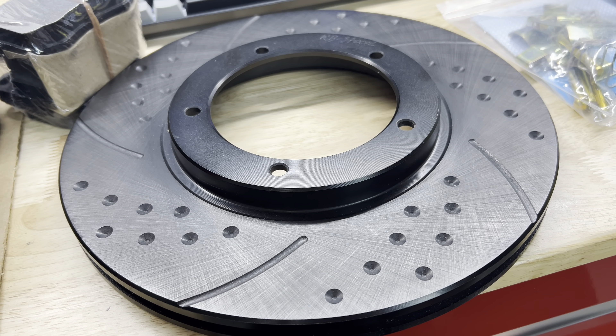Let's talk about pads. These are fully ceramic pads — not semi-metallic, just 100% ceramic. Most performance is going to come out of a semi-metallic pad, which has some metallic filler material in the friction compound. Those give you the most performance, but they're the loudest and generate a lot more brake dust. Ceramic pads are more durable, quieter, and more expensive. For my use case, I want to keep my wheels clean while still having solid braking performance, so ceramic is a good middle ground — plenty overkill for the type of street driving I do.